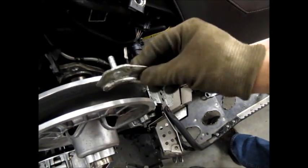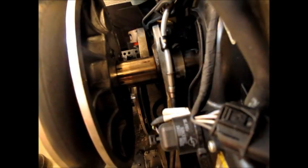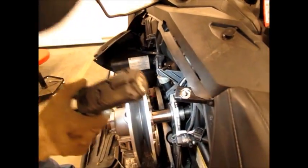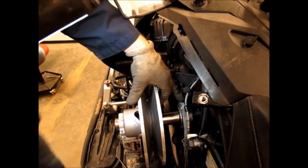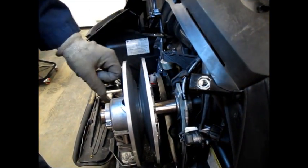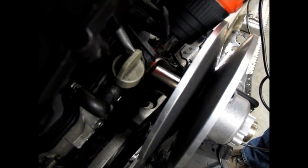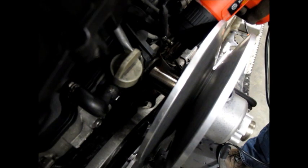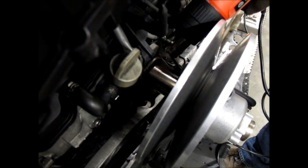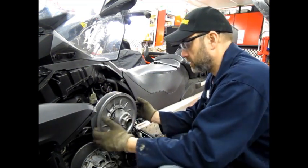There you go — that's what's holding basically the bearing in there, so we've taken that out. Now this thing can be pulled out. SUV recommended that we apply a little bit of heat on the bearing holder here to expand it, and we'll do that with the heat gun — warm it up a bit so that when we pull on it, it comes out a little bit easier. I could be using a torch but I don't want to ruin the bearing and with the heat there's a lot of plastics here, so we'll stick with the heat gun — less heat but at least you can control it.